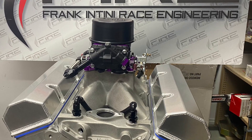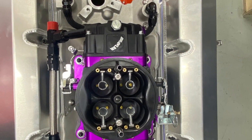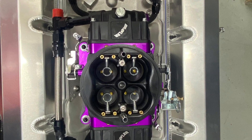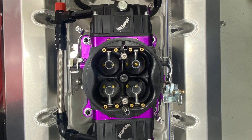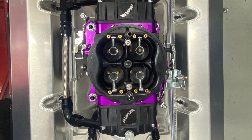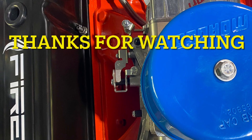I actually do it to every single engine that I build with this configuration — that's what I do, and I'd recommend you do it too. For anyone dynoing engines on my dyno, just to prime the water system and get all the air out of the system, it's so much easier when you've plumbed the rear of the heads in this fashion. Anyway, that's the first of this tech series — I hope you guys enjoy it. Short, sharp, and sweet — we'll see you on the next one, thanks for watching.